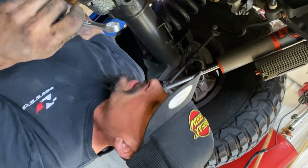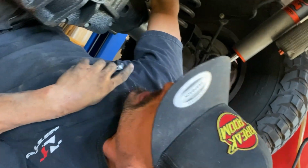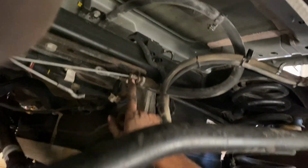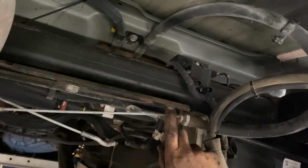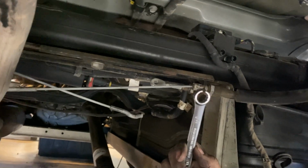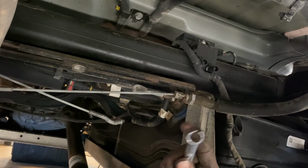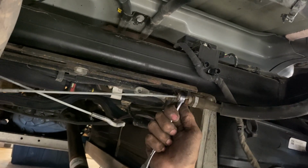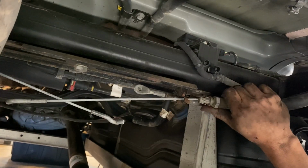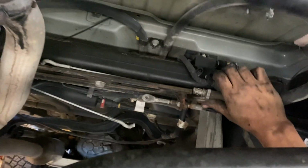I'm sorry. So I know everybody's fought with these because I used to fight with these. The e-brake cables that have the clip in the round thing, and you can't get them out because there's a bunch of fingers you have to push all at the same time. So you take a 13 millimeter box end wrench and you just cut a slot in it so that it fits over the cable. Then you take this 13 and you just run it over all the fingers and it comes right out. Tech tip of the day.